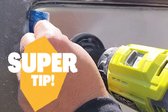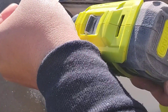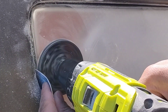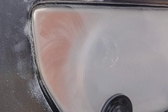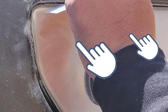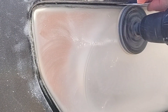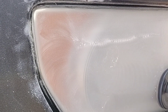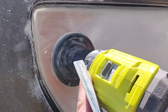Hold on — pause that. Check this card out here. Pro tip: you can always use a card like this in those sensitive areas, even if you're taping. You can drag along with it to hit those outside edges. You don't have to worry about the edges where it butts up against the plastic or the vehicle's painted clear coat, which you don't want to mess up.